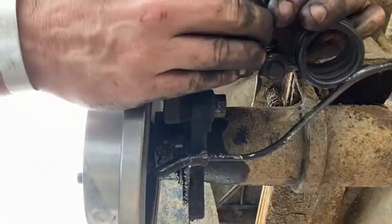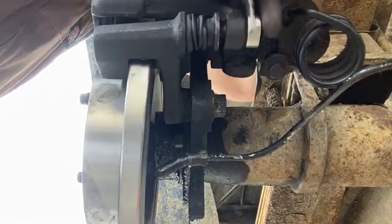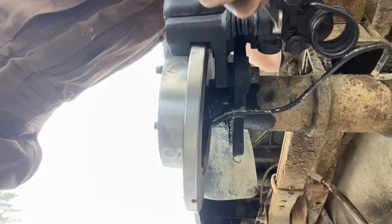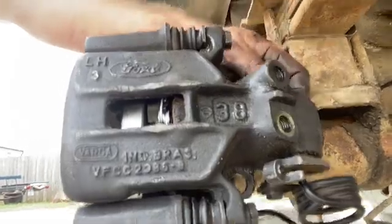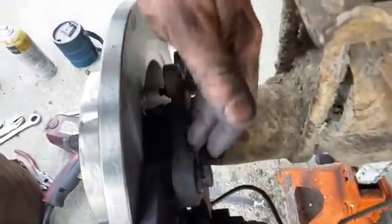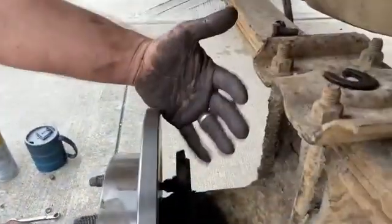Okay, let's see. Now, 13mm wrench to snug everything up, and this side is done. What you end up with is, here are your 2 caliper mounts, and then your caliper mounting bracket goes here on this entire mounting bracket. Rotor's right there. The only thing left is this brake hard line has to go onto your brake flex hose. So that's what we're going to do now.